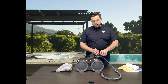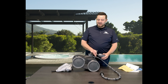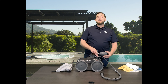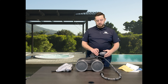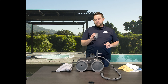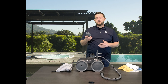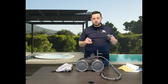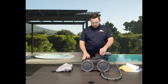There's a float on the back of the cleaner so it doesn't take off and do wheelies — if it's doing wheelies, something's wrong. Typically that means the float has a crack and is taking water, so it's not keeping that front end pushed down and the back end moving like it should. It literally just slides off. Check the comments below for the exact part number — Pentair makes a version, Zodiac has their own. If you want to keep it original and in the color scheme, check below for that part number.